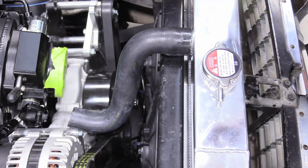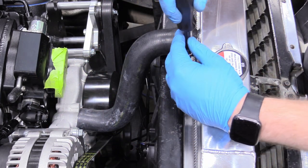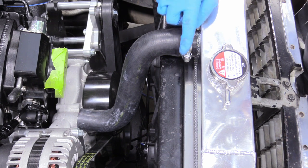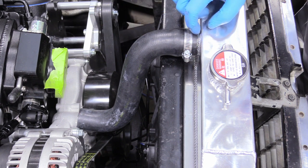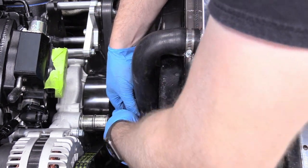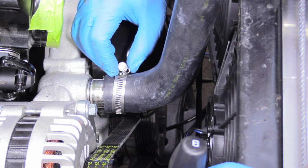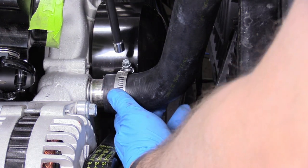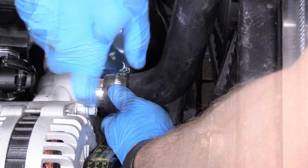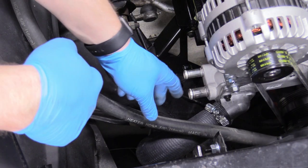Alright, got the top hose on — grab our hose clamp. Once you get your hose clamp in place, tighten that down. I like to leave the clamp screw pointing up rather than sideways, because if anything interferes with it it'll hit it, so pointing up keeps it out of the way. Then put the other end on to our water pump — make sure the hose clamp goes right behind our first barb, make sure it's not going to interfere with the water pump pulley, and tighten that down. Upper radiator hose installed!